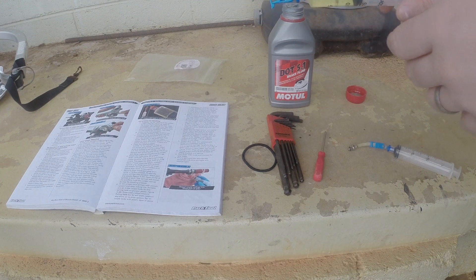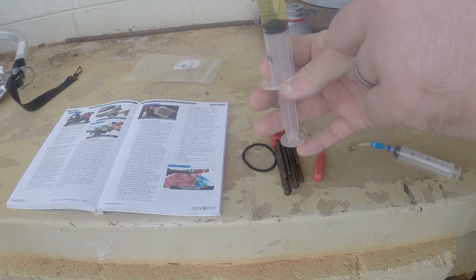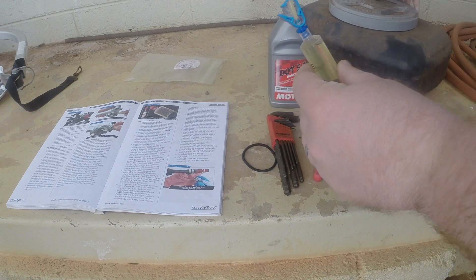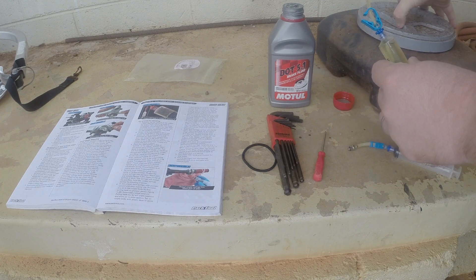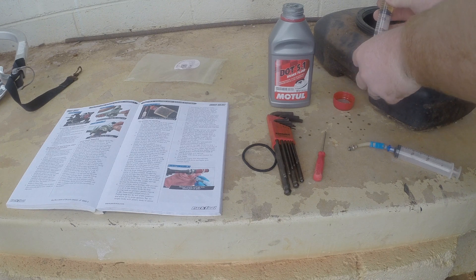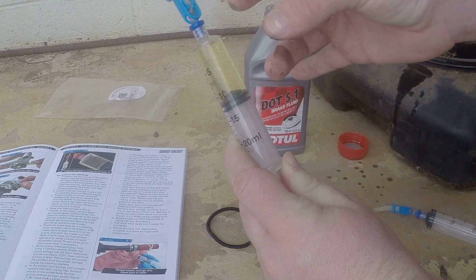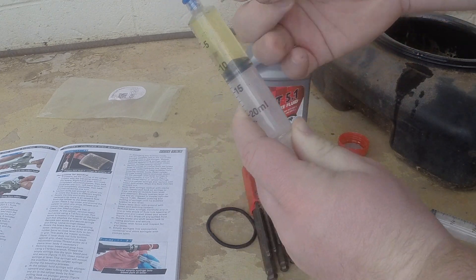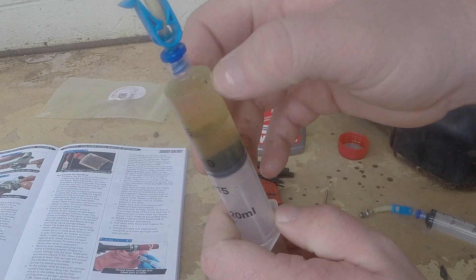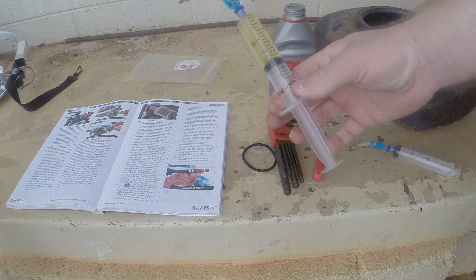Alright, so you got that all clamped down. You're gonna notice at the top you'll see a whole bunch of bubbles — there's a giant air bubble, and that is something you do not want in your brakes. So undo that clamp. I'm just going to push out that bubble the best I can, close it, then pull back and you'll see all those bubbles pop out. Gently tap the syringe to get all the bubbles to the top — you don't want to break it. Keep tapping until you've got your syringe all set with fluid and no air bubbles.